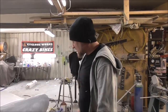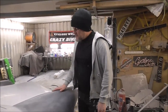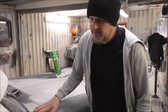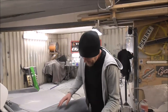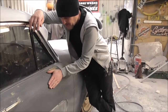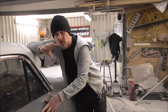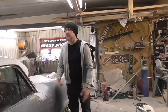This is where we've got to with the non-standard. Now this paint wasn't too bad, but I thought: I'm doing the roof and I wanted to repaint the bonnet and the boot, and then there were a few bits around here. I thought, you know what, I'm going to block the whole car down. So I've done this all with a hand sanding block and blocked it all down, going around the body feeling for any sort of imperfections. Because as good as you think you've got it, when you paint it it'll look rubbish - the tiniest of imperfections will show up, especially if you're going for a high gloss finish.